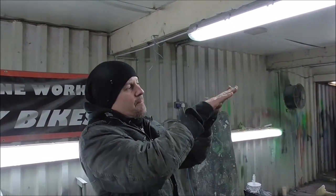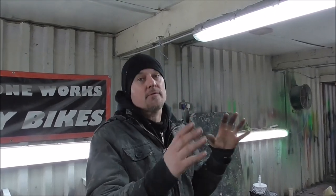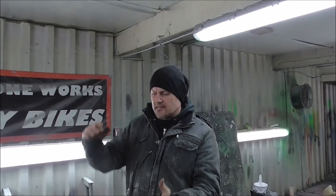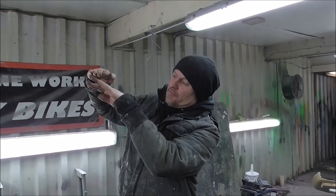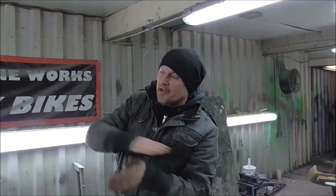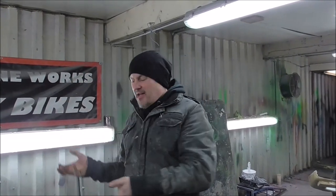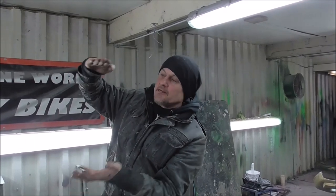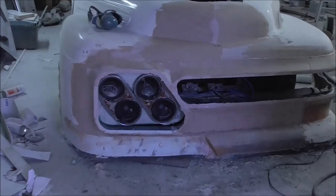So it's not in the video, but what I also did at this point, once I had those big curves around that front piece, once I had all of those glass, and they're this thick fiberglass that gives some real structural rigidity, then I was able to cut the slot of the front fender out so that that whole piece is now open. And it's those two big thick chunks of fiberglass that hold that, so it's got that sort of cantilever effect to the front.